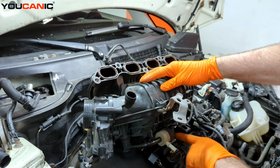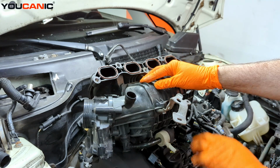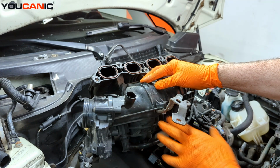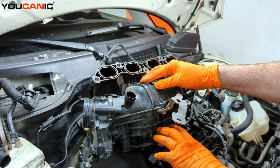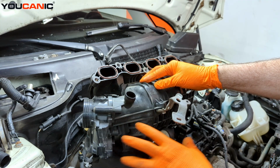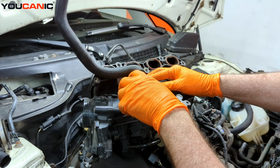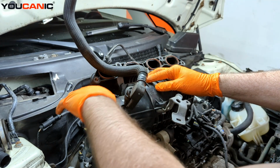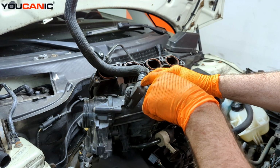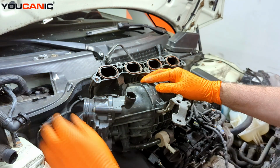We have an electric connection. It's one of these that connects to your purge valve. So if you were needing to replace this purge valve, you can do this from down below, you don't need to remove the whole unit. Squeeze this connector, unhook that, and then undo the rubber grommet that holds this on, the electric connection and this hose, and then that way you can replace that purge valve. This is where this goes, but you've got to make sure that it spins up like that and is nestled into this hole for when it gets in there. But you don't want to put this on until you drop it down in the hole, because it gets stuck on the fuel rail. So we'll set that aside.